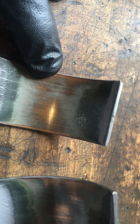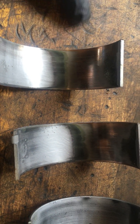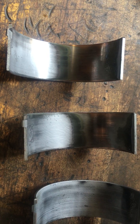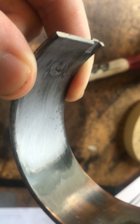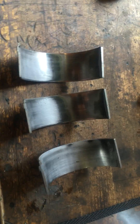This one right here — it makes sense if you had low oil pressure in the engine, the bearing wears down. The engine works, but with these bearings almost gone, you've got low oil pressure. This here is a pretty good-looking, normal rod bearing by comparison. When the rod bearings really start wearing, the color comes out.